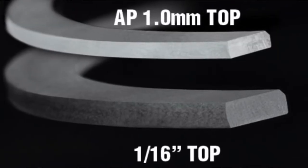Okay. So, this is not a structural component of the piston, which means you don't have to be afraid of going to a thinner ring and it hurting the piston. It's not going to hurt it in any way. If anything, that thinner ring is going to have better bore conformability. It's going to follow that cylinder better. It's an odd thing. Doing what we do all day, and as long as we've done it, there was that day where you had the 5/64 ring, and then that skinny 1/16 inch ring. Man, I'm not sure about that 1/16. Then it was, man, that old .043. Oh, that's high-end racing stuff. Rebuild it every race. Can't put that in there. That will never hold up.